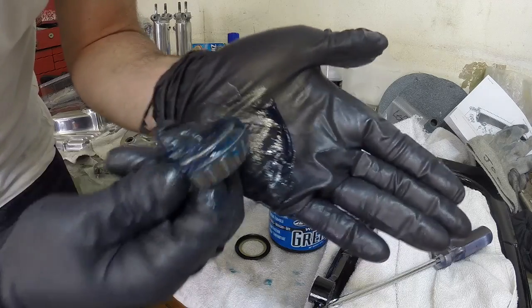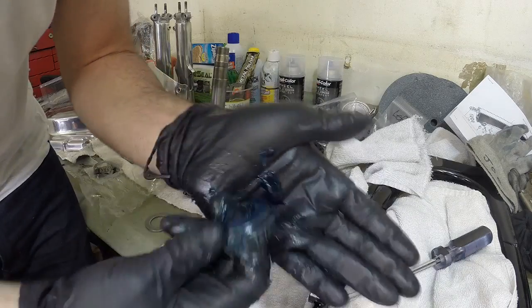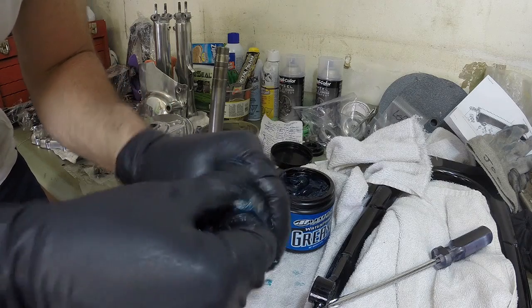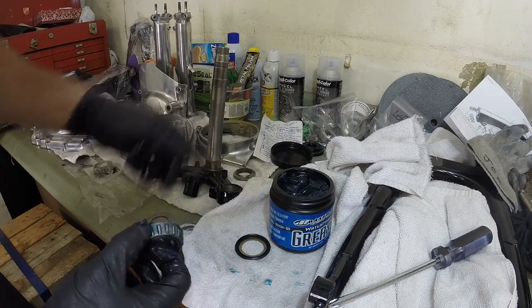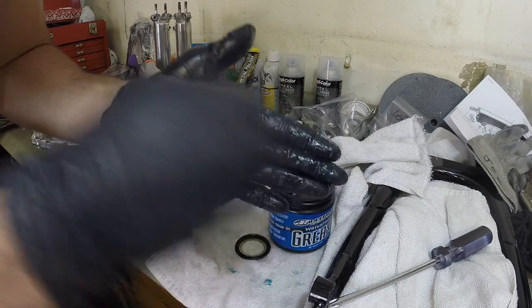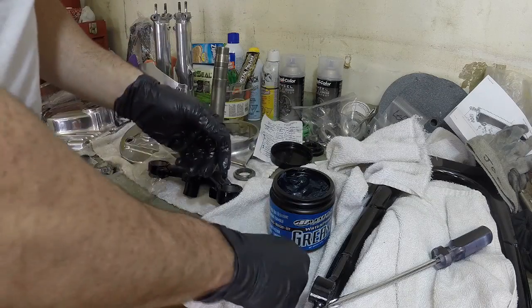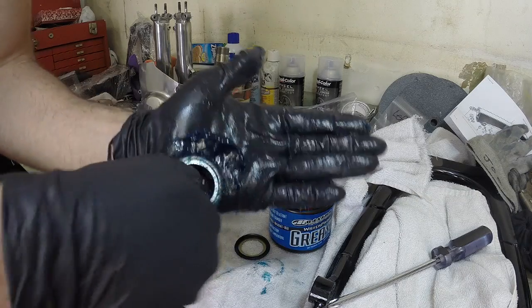And then I gotta get this onto my steering column here. So the way it goes is that you need to figure out the spacing for your steering stem. You want to match the stock bearing length. It comes with two washers, a thick one and a thin one. What we'll do is we'll measure the old bearings, and then we'll stick the new ones in.